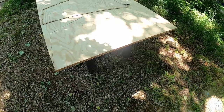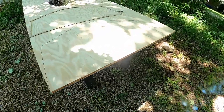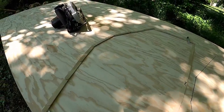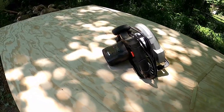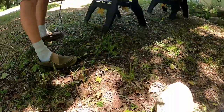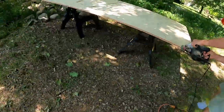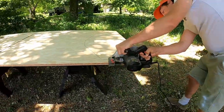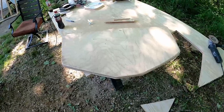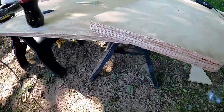My transom was an inch and a half, so we went with 3/4 inch marine plywood, two layers. The stuff that was in there was inch and a half thick and 5 layers of plywood. This is going to be inch and a half and 16 ply once it's sealed together. So here I got both those pieces cut, sanded down, lined up pretty decent.